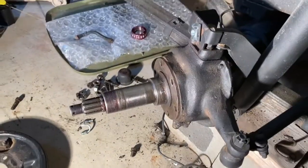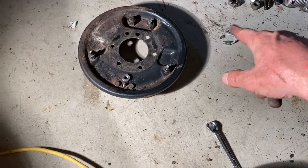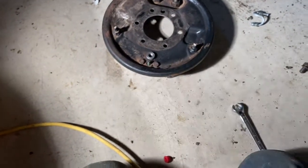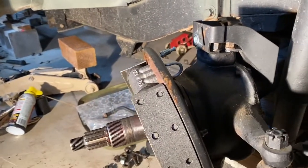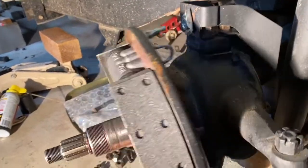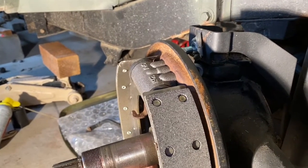Now on to the front and the home stretch. I've decided to use the new S brake hose — I'll attach it to the slave here first. The S tube is just hand tight; don't tighten anything fully with brakes until the end. I'll just lift it in place, position it, hand-tighten that as well, and then attach the bolts.